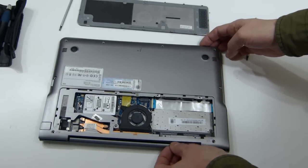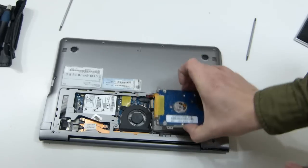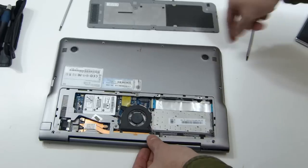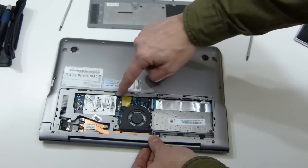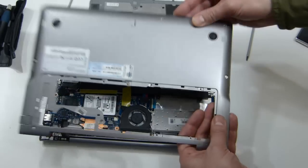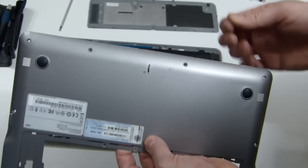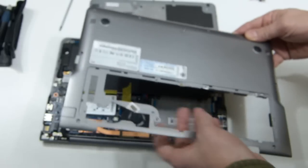What I've done is taken the rear panel off and taken the disc out — you have to do that first. Four screws, then flip the little connector up and take that away, then take all the screws out from around including those near the hard drive. Be really careful — this is metal and it's razor sharp. I actually cut inside my nail the first time, it was bloody painful. This time it's obviously a bit easier, second time around.